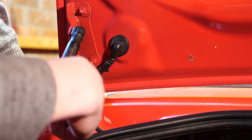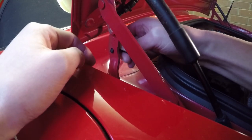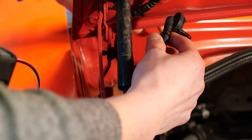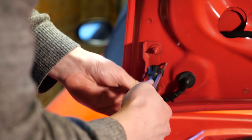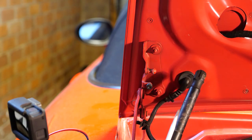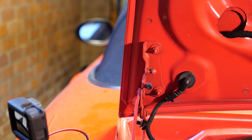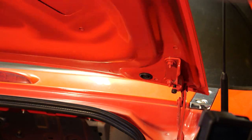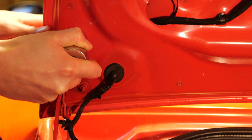The cable has a small retaining clip which stops it from getting trapped in the boot hinge, and this just pulls straight out. Next we need to remove the gas band from the gas strut, and these can ping off. The gas struts don't actually need to be removed for this process, but I found it easier as it takes 30 seconds and gives much better access for my ratchet. The design allows you to remove all four nuts without the boot falling off, as it uses nuts on studs rather than bolts into captive nuts.